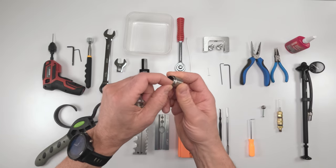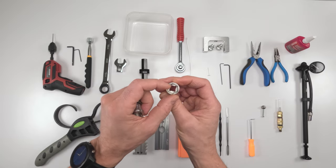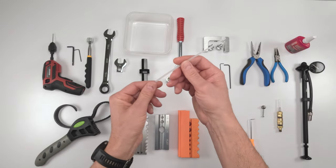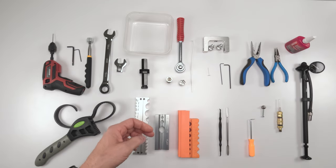This is a very thin edge, very hard to find. So if you happen to have one that works, I mean, it might work. I don't know. It's hard to find these. So you're going to need a ratchet for those two tools. Now take out the shim stack. I never take shim stacks out without a cable tie in order to keep things in order, right?